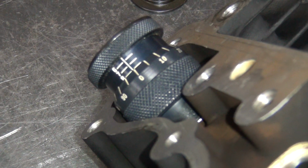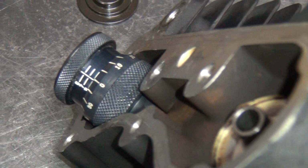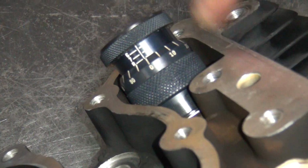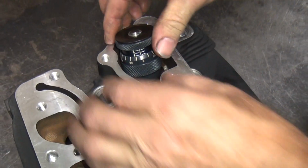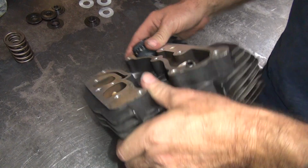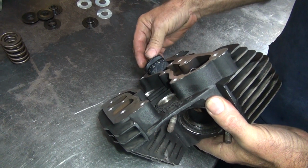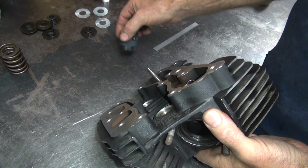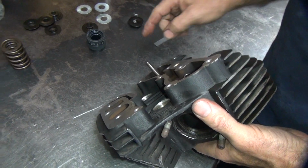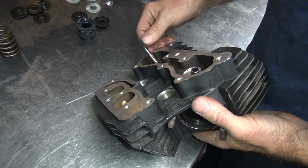Now we had 1.050 installed height plus 50 is 1.100. And you add in 6, makes it 1.700. We were at 1.800, so we got an extra 100 still in here. So right now this will take a pretty big lift cam. We got room for 600 lift. We had 800, because I got the seal, it was 150. We got an extra 50. That's 200. We had 8, that's 600, so it's got enough for 600 lift. Not 640, but 600. So this spring kit now is good for a 600 lift cam in this motor.